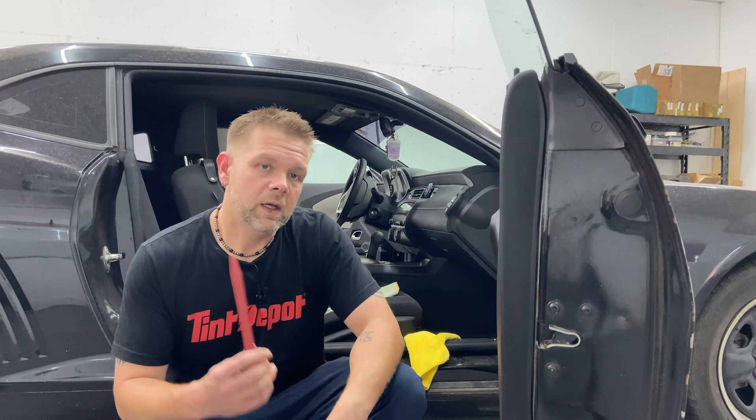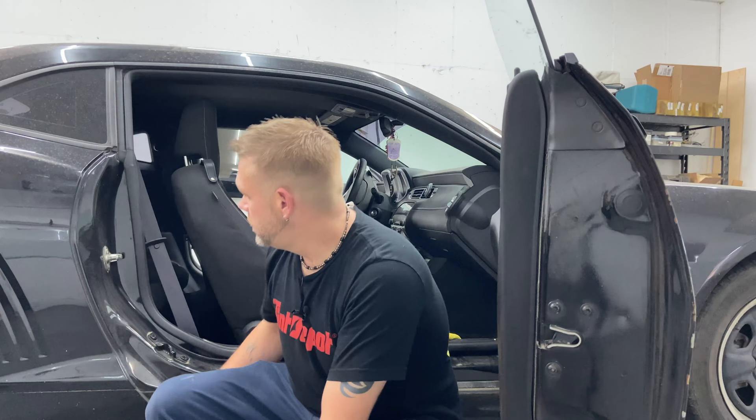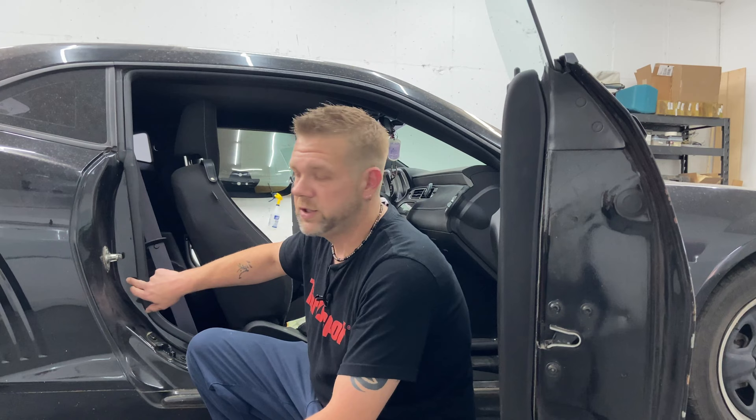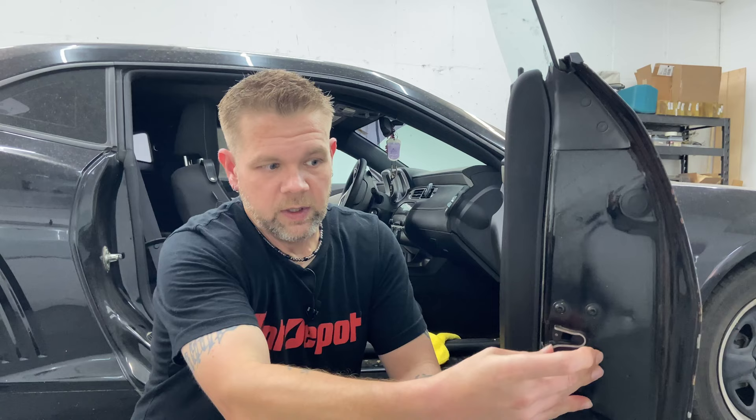The first thing we've got to do is trick the door to make the car think the door's closed, so the window stays up. On this particular model, along with Ford Mustangs and Challengers, you just flip the latch — super easy. On Nissans and some Infinitis, two-door frameless, it's usually a screw on the door jamb — take that screw out and unground it and that moves the windows up. On this model it's the door latch itself. I just take my thumb and push in on it, roll down the top portion, and when it clicks, push it one more time and it rolls the window up. Note: do not forget the windows are up. After you tint it, make sure you heat dry the bottom and click your handles before you close the doors, or it's going to be very expensive.